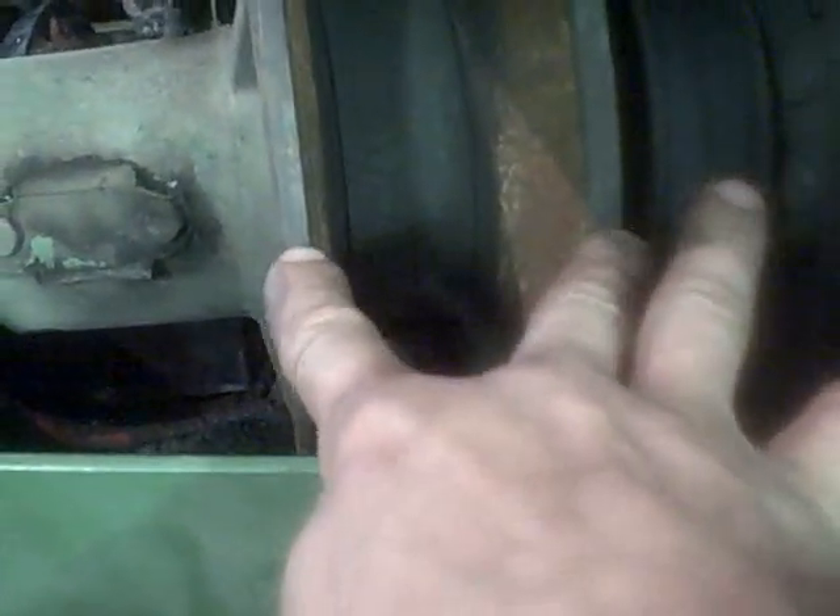What happens is the lever that I showed you earlier — this lever here that you push forward to go faster or slower — sets your speed. So that's hooked to a set of linkages. From underneath there, that lever moves a linkage that squeezes this pulley together. As that squeezes together, the belt rides up higher and spins the belt faster.